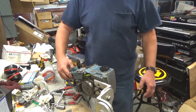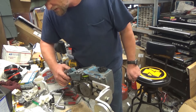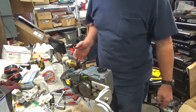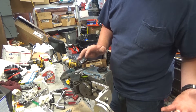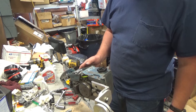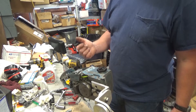These things were famous for getting the bar pinched — you'd reef on it to pull it out — and without those screws, that epoxy would break and either the oil or gas tank would start leaking. Whatever this adhesive is — I suspect it's an epoxy like JB Weld — it's holding the tanks pretty well, but it did leak a little bit. So I went ahead and lined it with red coat; that stuff stays flexible and fuel won't eat it.